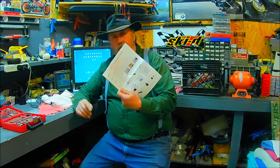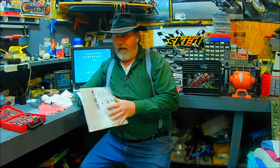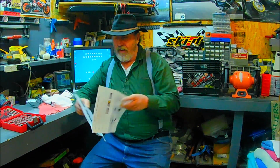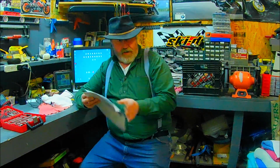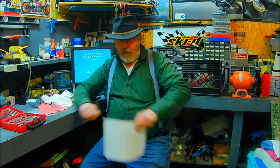So that's the Ryco Moto Turn Signal Horn Kit 8103. This is the manual for it. It's fairly well written. Pictures in it are a little small and dark, and it's pretty accurate. There's only a couple of things that I might recommend that they change. They're not really coming to mind real quick, but one of the things was that you have to make sure that you split the rear signal harness apart. It comes like a zip cord, and you have to separate the two conductors and run one to the left and one to the right.